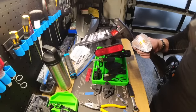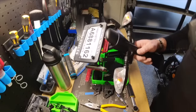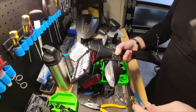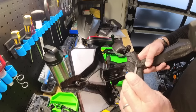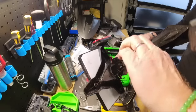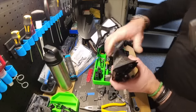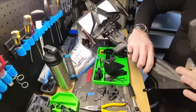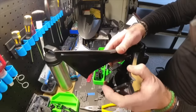Here we have the OEM rear setup — the left and right indicators and the ugly tail that comes with it. We're going to loosen up the left and right turn signals, which come off pretty simply. Then we just need to remove one more screw to take the rear tail section off so we can pull the existing wires through. This section just pops straight off — remove this plate, you won't be needing that, it can go in the trash. Just carefully expose these wires and pop them out on either side.